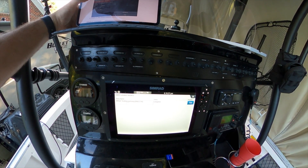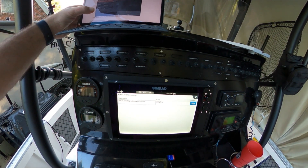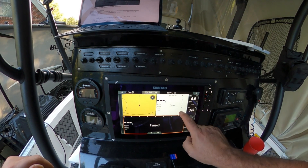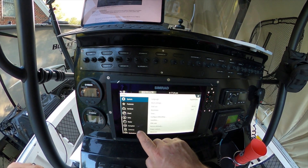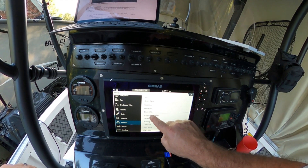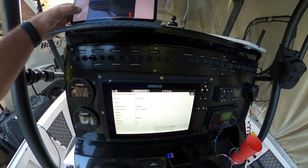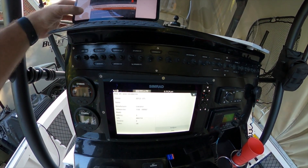Go into Settings, Network, and Device List. Verify that the MotorGuide GPS software version is ending in '100.' It appears everything went normal. Go to Settings → Network → Device List → MotorGuide GPS. The version reads: 1-1-0-0-1-0-0-0-0-2. And that's what I upgraded to — correct.